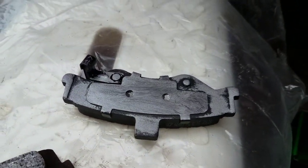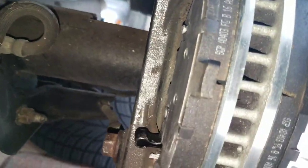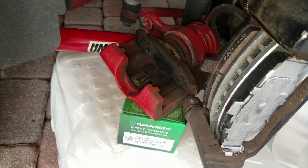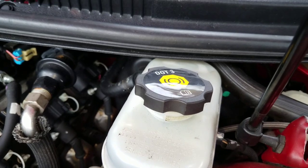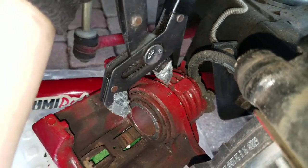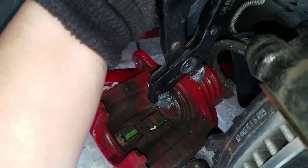Got one end smeared on there nice and light. When you install the rear inner brake pad, that clip is on the downside. When it comes to the front, that clip will be on the top side — but make sure it's down on the bottom so it'll all go in correctly. When you go to compress the piston back into the caliper, pop the cap a little bit on the brake fluid so any air can escape. While compressing the piston back in, I had to use what's called a robo grip. There are other methods, but I didn't have the proper tool, so I clamped it around the rim and compressed the piston. Also, when you do this, make sure your parking brake is off.